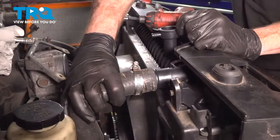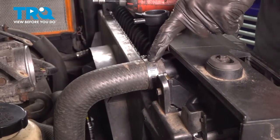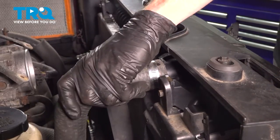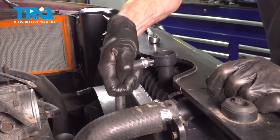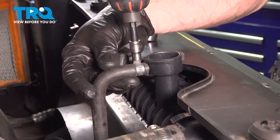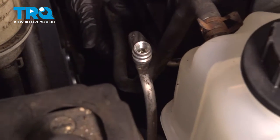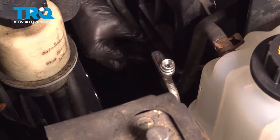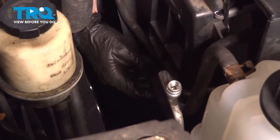Now we can connect the upper radiator hose. Slide the clamp into place and make sure it's tight. Now let's grab the overflow hose, bring it under the upper radiator hose, and put it in position on top of the radiator. Tighten the clamp. Follow that hose down to its connection point inside the fan shroud — it's going to fit into the top clips. Press it right in and make sure it's secure. While we're down there, put in the other hose that goes directly underneath it.